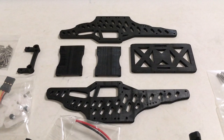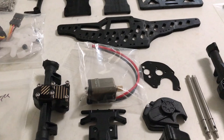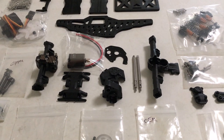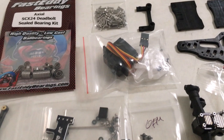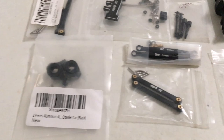The kit is pretty basic: you've got a roof, an ESC tray, battery tray, and optional servo lights. Another unique thing about this chassis is it was designed around an 030 motor, so not a lot of space in there. I picked up the new 030 Torque Beast from MoFo — a little slower with the stock pinion than the stock motor, but should have tons more torque. Everything else is fairly stock, though I did pick up a black label servo and an aluminum servo mount with aluminum steering links.